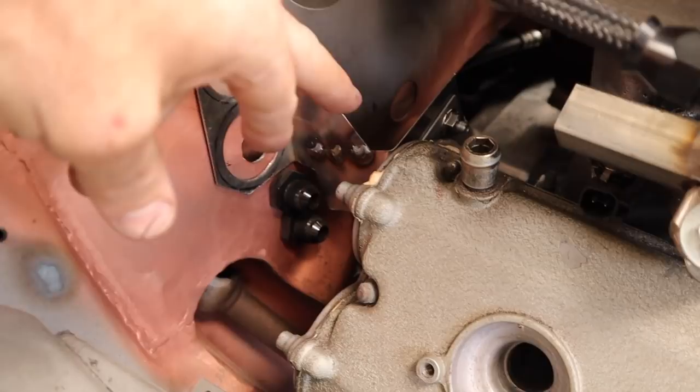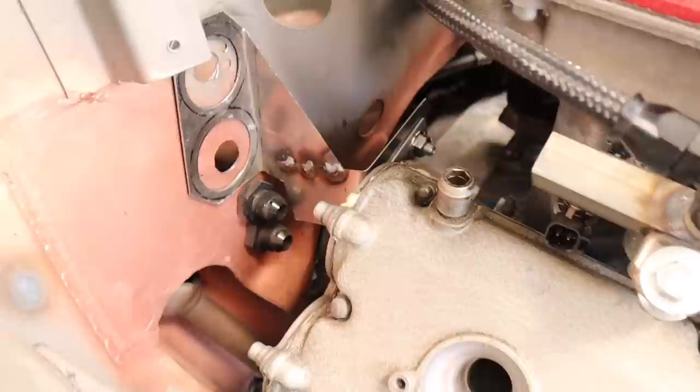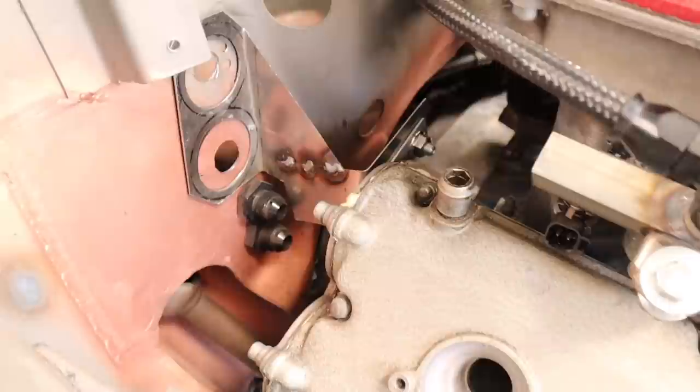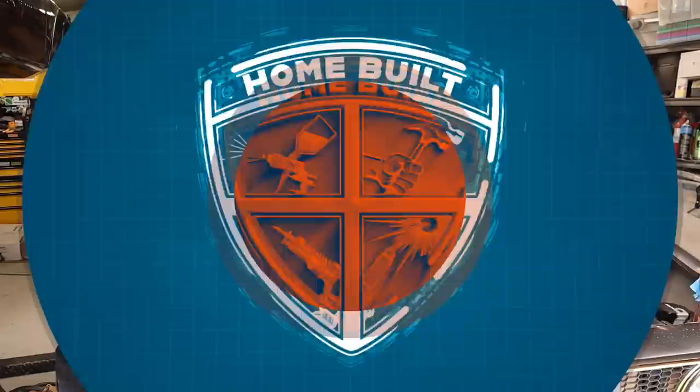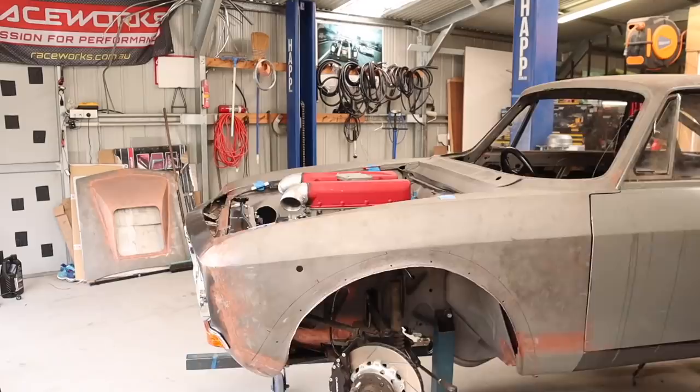You can see this frame I built here — that is exactly where my two bulkhead connectors are going to go in. I just welded it onto a little bracket that bolts onto the side of the engine, so when I take the engine out I still have the exact location of my bulkhead connectors. Everything is marked out, so I think it's that time again — time to take the engine out again.